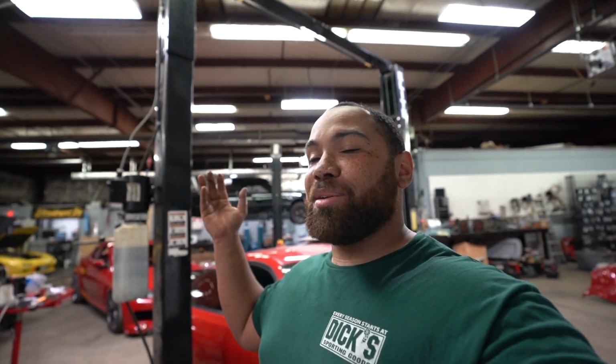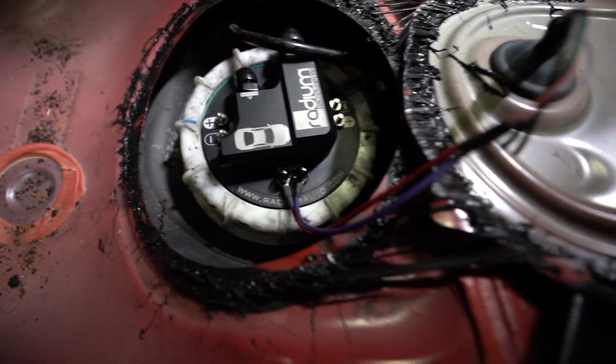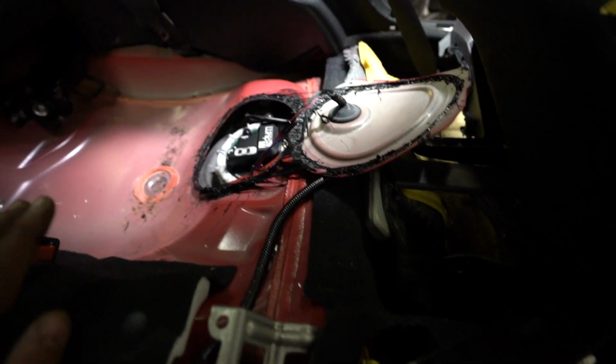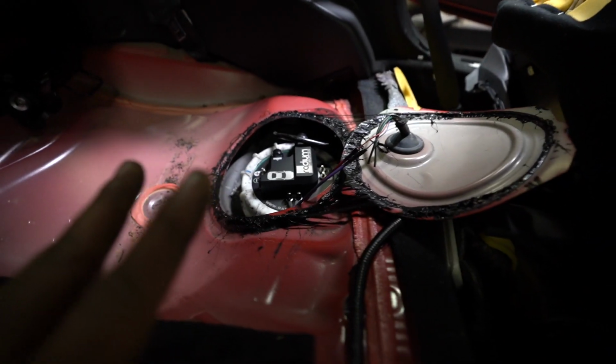It's in the car. Heat shrinking. Gonna attach the wires, then the fuel sender wires will be wired. We don't know if they're gonna work, because I couldn't remember which ones I had were the power and ground to the actual plug. So we'll see what happens. We got it. It's in. Boom. Got the fuel sender lines all wired up. Heat shrink too. So those are all good to go. We'll leave that like that for now until we're ready to do everything else, and then we'll be able to seal that up.